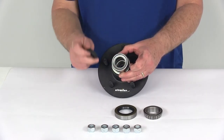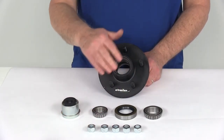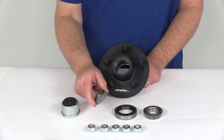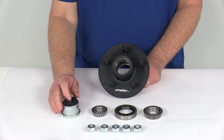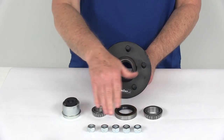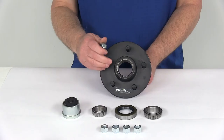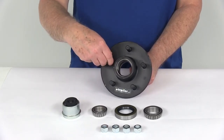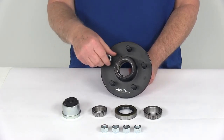As mentioned, you can remove the plug and get access to the Zerk fitting on the axle. For this video I'm just showing where the parts go, but when you install this for the first time, make sure both bearings are greased very well before installing them. From then on, you can use the EZLube to maintain the grease in the bearings. Also included are the 1/2 inch by 20 lug nuts, used to hold your tire and wheel assembly to the hub. Put your wheel up on the studs, put your lug nuts on, and torque them down to the correct specs for your application.